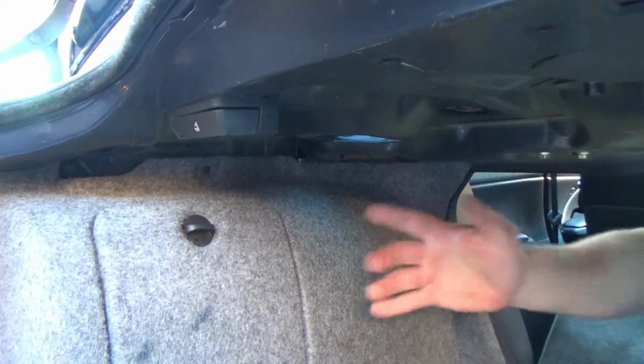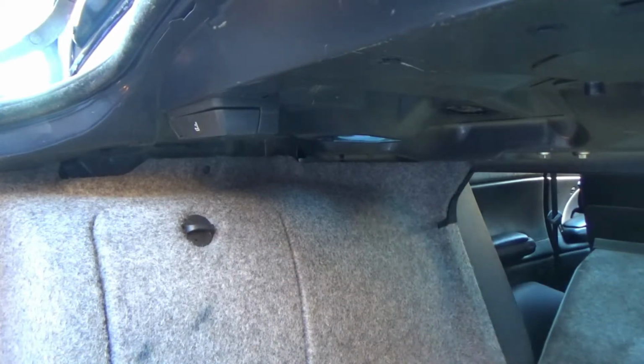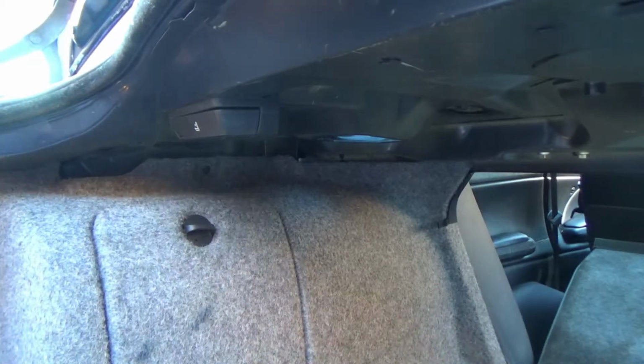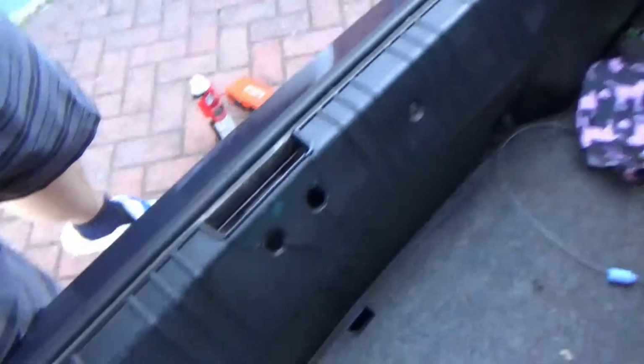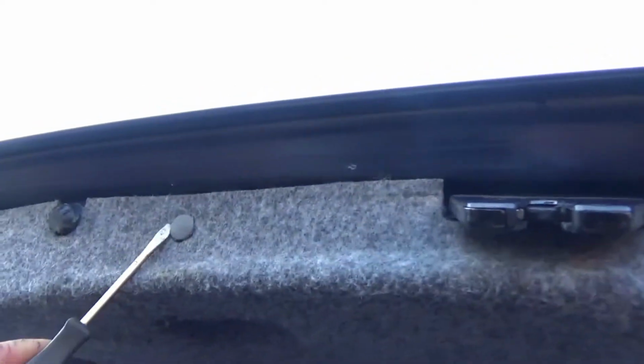Now once you're into the back of the vehicle, you can then, probably with a torchlight, work your way around in there using the flat blade screwdriver to remove the plastic pins from the liner of the boot. On the inside here, don't mess about with that bit, it's irrelevant, doesn't help whatsoever. I broke mine trying to do it. So there's the studs, you can see the little plastic ones, pop them out, remove the liner,